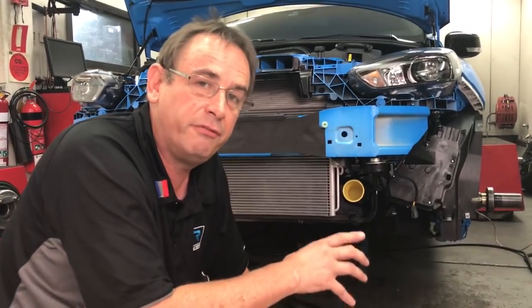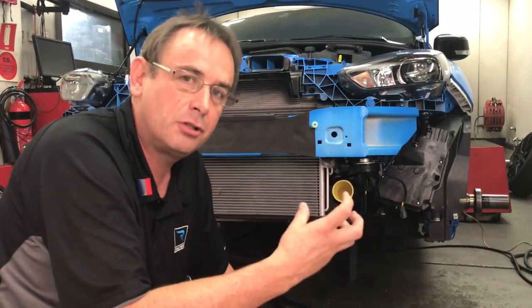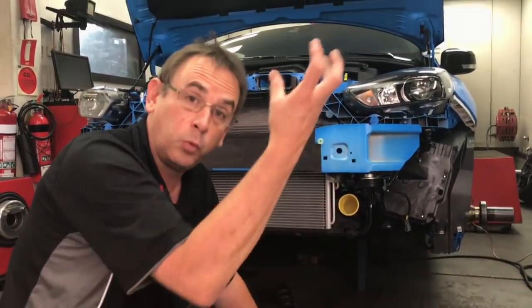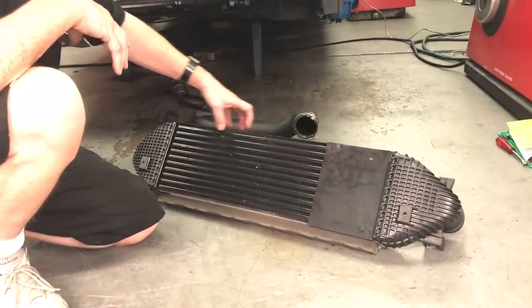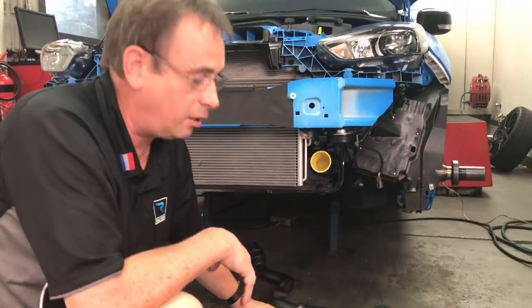What they actually found was in environments around the world where the ambient conditions were very humid — meaning a lot of moisture in the air — when the engine induces air, takes it into the intake, goes through the turbo and gets compressed and hot, when it goes through the intercooler it starts to cool. When you cool humid air, like with an air conditioner, water comes out — the water condenses into droplets out of the vapor, which is the humidity. In an intercooler like this, they found that in certain situations it starts to form large droplets, which get through the intercooler and into the engine, causing misfires. So Ford said, for a global car, we'll just reduce the performance of the intercooler and tolerate a higher inlet temperature to reduce the risk of that problem — hence the blanking plate.